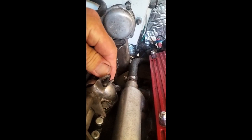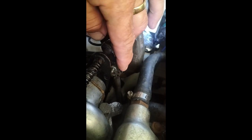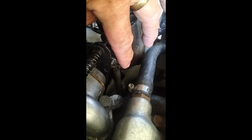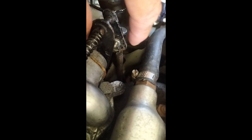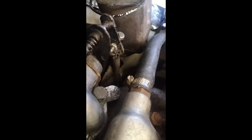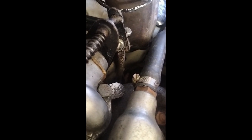At the moment the carburettors are going really well with the new jets and the airflow is balanced, but I really want to see if I can invent something to just take that movement down a bit. This setup is all a bit homemade. The angles are all wrong — the spring is almost trying to pull in exactly the wrong direction. I'm going to see if I can make something which comes out almost perpendicular from the current lever, and then attach the spring further out. I'm a mechanical engineer so I'll get my pen and paper out.